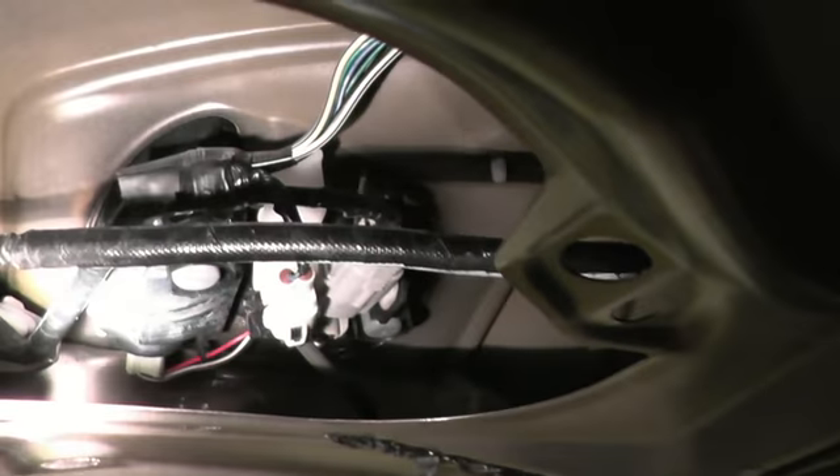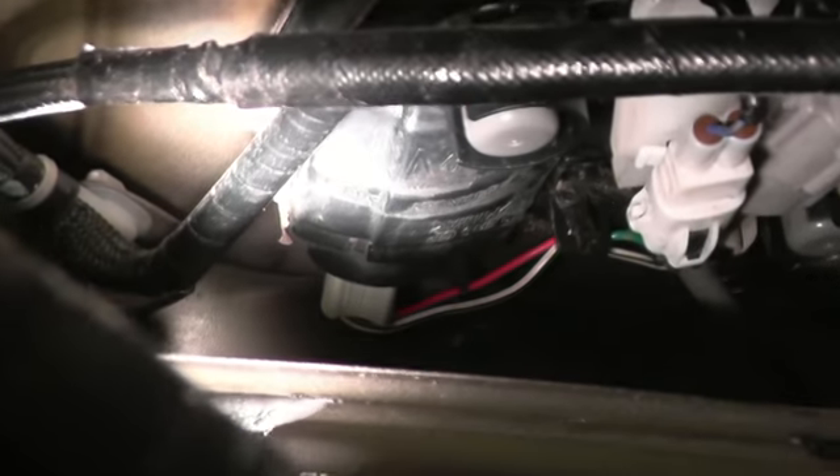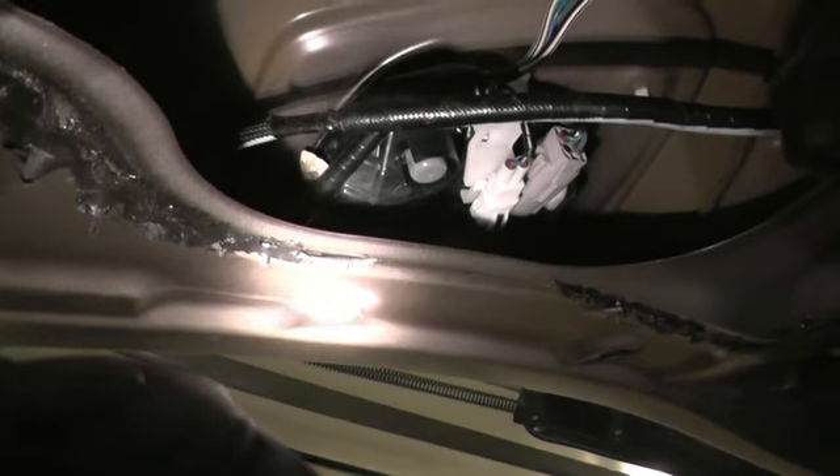It's very hard to see, but right there — that's the plug, the light bulb. I'm zooming in so you can see. You can't get to it unless you remove the tail light: two bolts and that clip. That's pretty much it on the driver's side, and then the reverse step is the same thing.